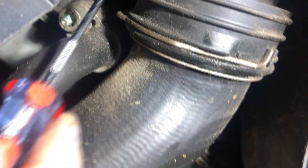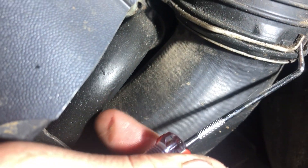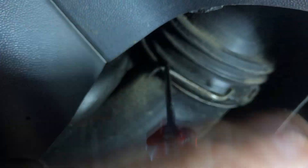As a bonus step: grab a flathead screwdriver or a pick. On both the driver's side and passenger's side, underneath those first covers you removed, is your turbo charge pipe. Pull the clip straight back, then grab the hose, pop it off, and drain the oil out of it.